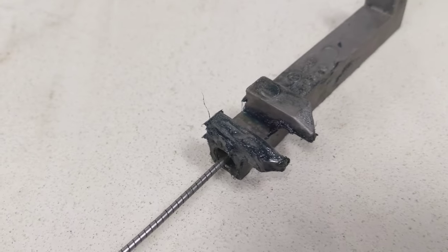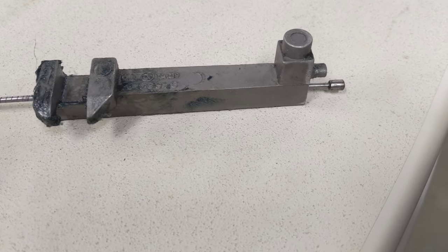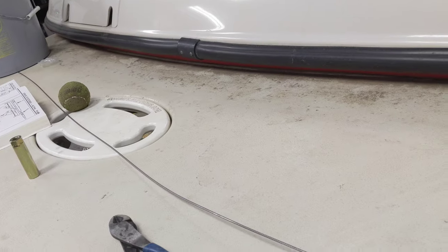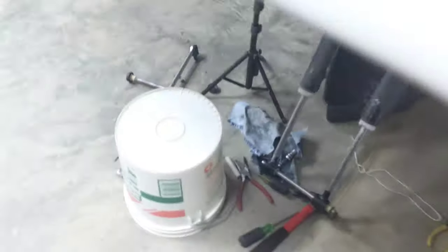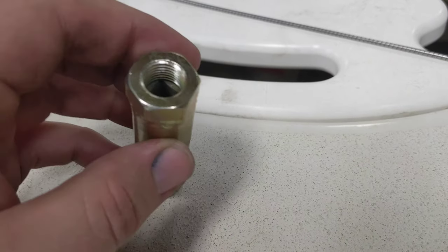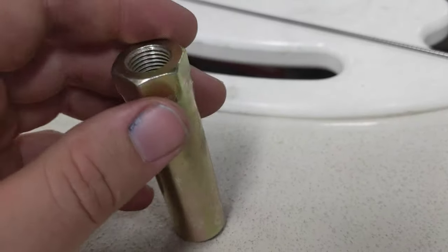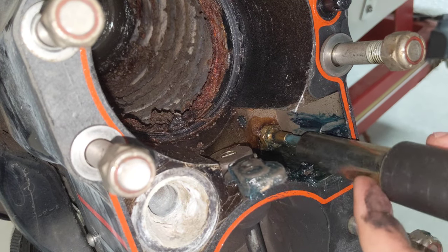I got the inner sleeve pulled out of the shift cable. This would be the end that's outside on the stern drive side, and obviously that won't pull out easily — it's a hard yank, you can't get that off. So you have to pull all of this out the back of the stern drive. That little blue tube is where it comes out. To remove the next section, you use this special tool — I don't remember the part number, hopefully I'll put it on screen — it's a tool from Amazon that fits on a three-quarter inch socket.